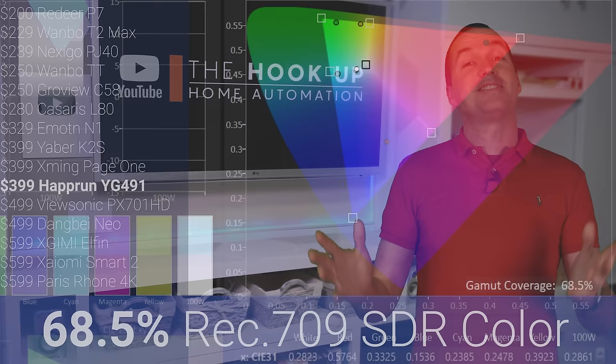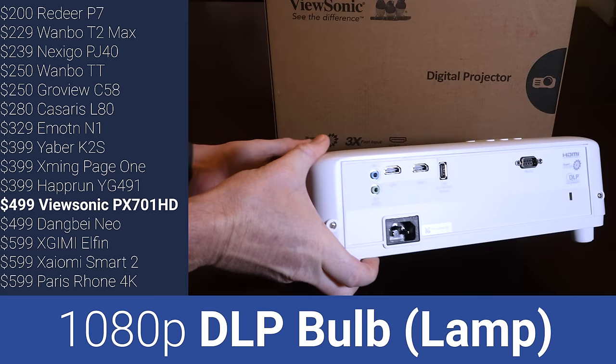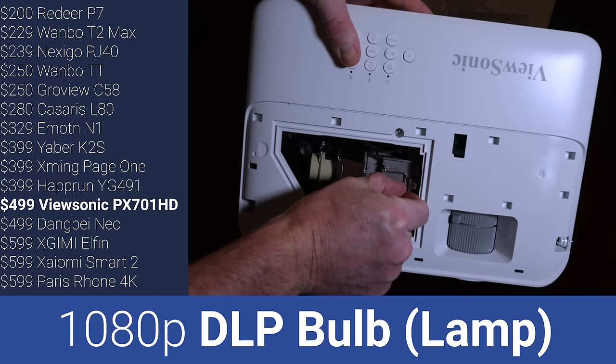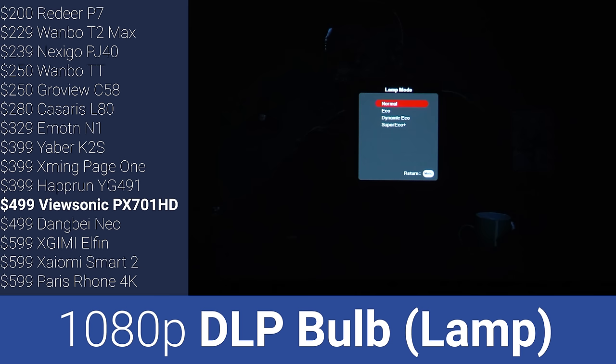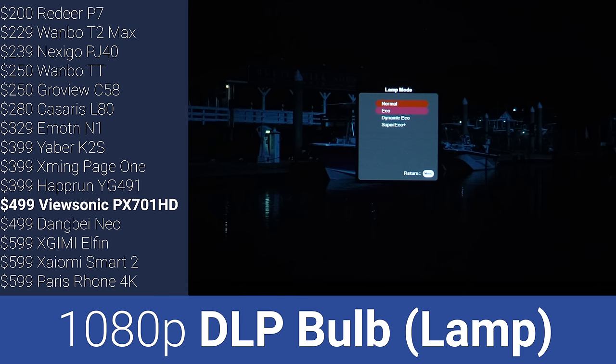But next, for $499, is a completely different projector technology. The ViewSonic PX701HD is a 1080p DLP bulb projector that uses an older technology high-intensity discharge bulb combined with a spinning color wheel and digital micromirror display to generate a very bright image with a more economical upfront cost. Some minor downsides of bulb projectors are higher heat generation and power use, but the biggest issue is that on normal brightness, the bulb will begin to degrade after as little as 500 hours and will have a significant drop in brightness and color accuracy at around 2,000 hours, with most people opting to replace the $150 bulb every 3,000 hours or so of viewing.